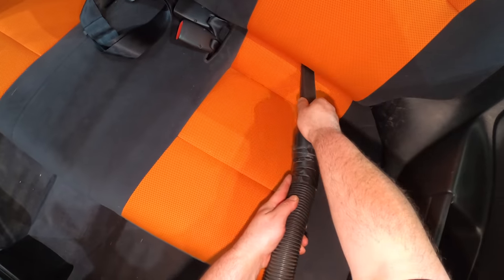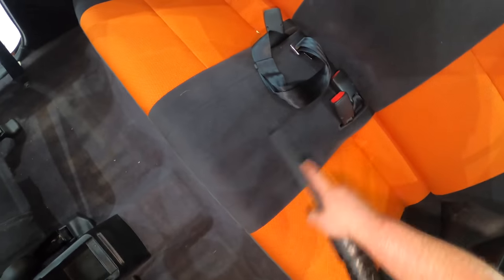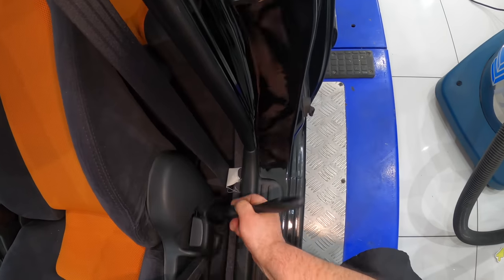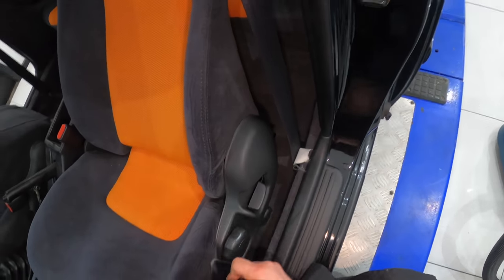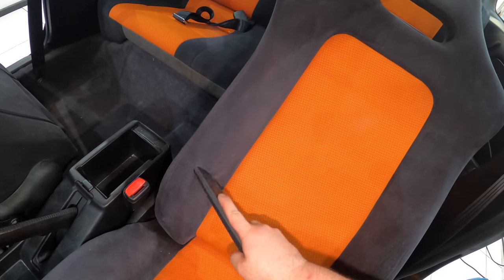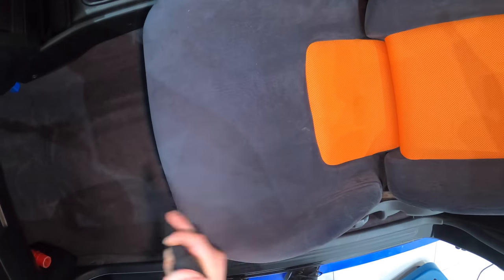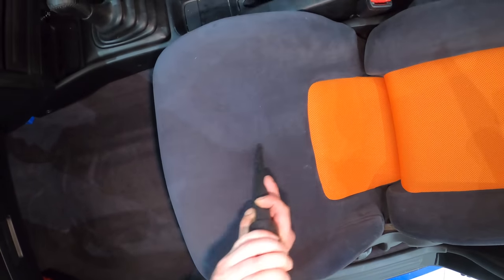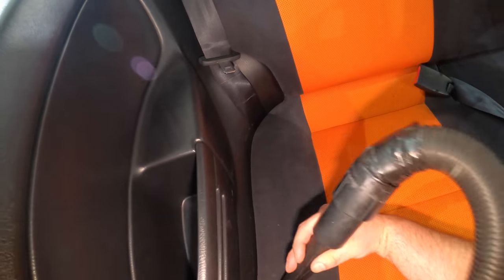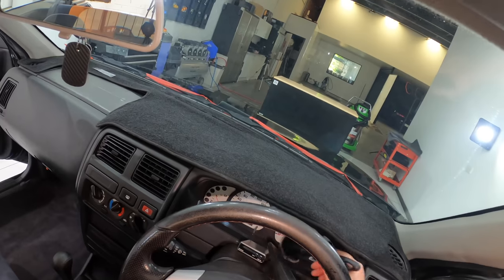on videos. From a longevity point on the interior materials, you need to understand that you're not doing the car any favors by grinding all those looser particles, which act like sanding abrasives on the fabric, leather, plastics, and other trims. Ultimately, you're prematurely wearing down the interior cabin trims if you don't do a good, thorough dry clean before you even think about moving onto a wet clean. And additionally, your cleaning chemicals just aren't going to work as well if they have to fight through all that looser dirt before they can get to the embedded grime beneath.